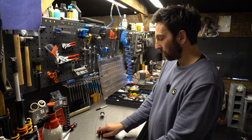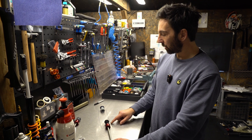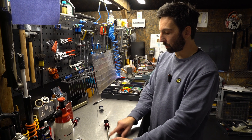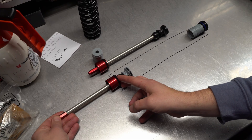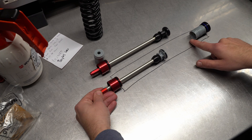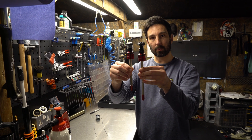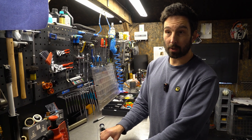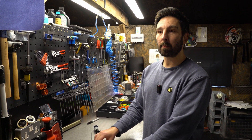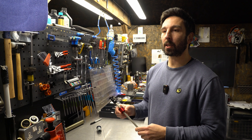You can see the travel from that air spring — this one is 170mm travel, so the amount of volume it uses is preset by the length of this shaft. If we use a shorter one, it uses less of that volume, so the same stanchion can be used for different air spring travels. In a fork with less travel, we need to use more volume spacers to get the same feeling of ramp in the system.